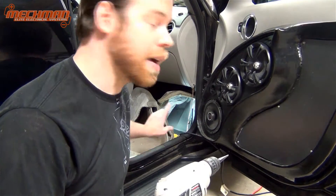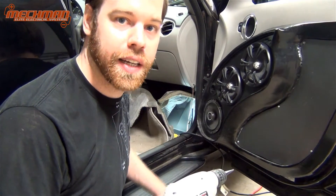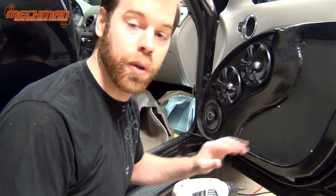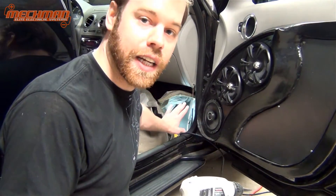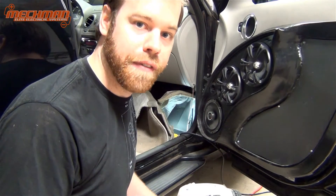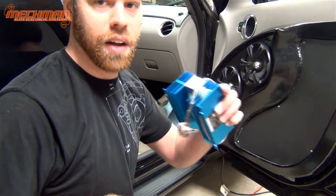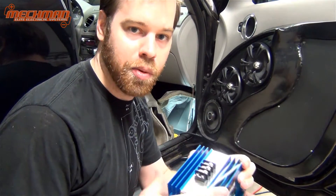What I'm doing now is drilling a small hole through the firewall. When doing this, it's important to double-check — maybe triple-check — before you drill. I made sure that on the other side of the firewall it's clear: no wire harness, no coolant lines, and no engine components mounted on the other side. I have a free and clear space on the inside. I peeled back the carpet and insulation to get to the metal of the firewall itself. I'm running through the firewall right now to run the wire for the regulator — I want to mount this knob on my dash, so I'm going to have to run a couple of wires through.